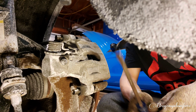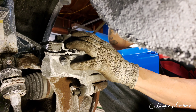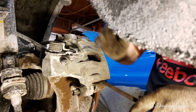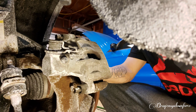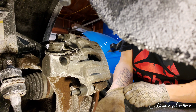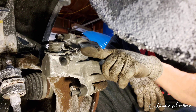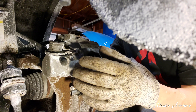Now you're gonna get your flat head screwdriver or your pry bar — whatever you have — and we're gonna take off the brake calipers. But before we take off the brake calipers you've got to take off these pins. Now that we have the retaining clip off in the front, before we take off the caliper we'll take off the e-brake, that way it's easier to remove the whole caliper.